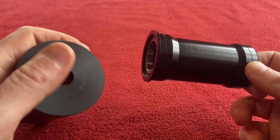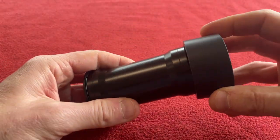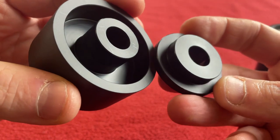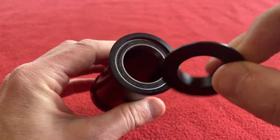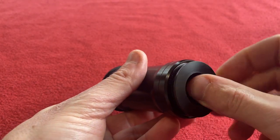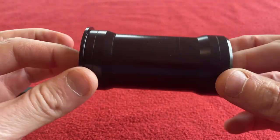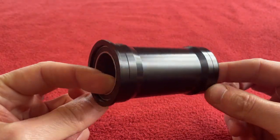You can de-press it out of the frame — I'm not even sure of the technical word, un-press maybe. That's a delrin sleeve. All the tools to put it in are there. So you can just press it into your bike with these delrin sleeves, which are beautifully manufactured. In order to fit the Shimano spindle it comes with delrin sleeves — they sit over the bearing face and then you press them in. That is the Shimano spindle diameter. Press this into your frame, put in the sleeves, job done. One piece so there's no creaking, no misalignment — they're perfectly aligned so my crank will spin very freely.